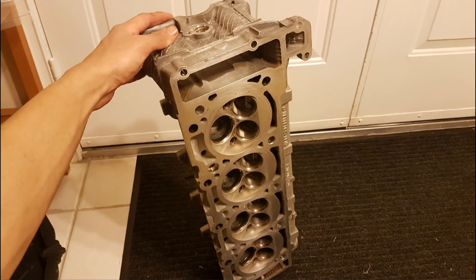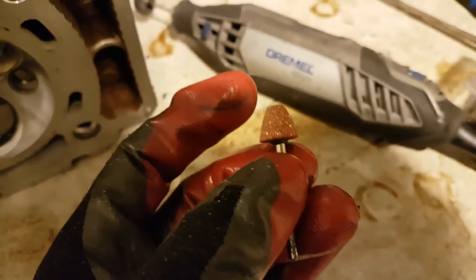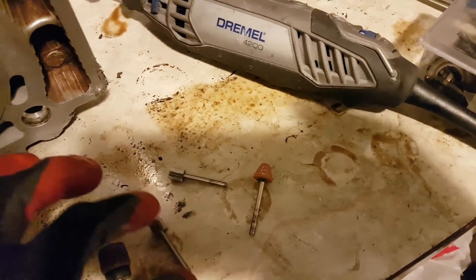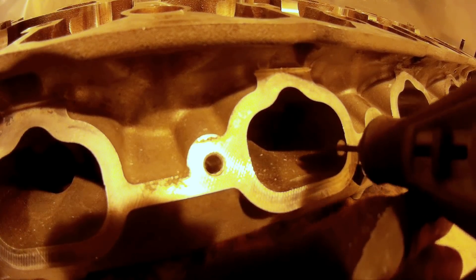Here's what the head looked like after an awful lot of cleaning. Once the heads were clean I could finally get to porting. The tools I'm using are just a Dremel with various bits: a cutting bit to enlarge the ports by a bit, another bit for hard-to-reach places, sandpaper to get rid of the edges the cutting bit leaves, and finally a polishing bit with metal polish. I started with the cutting bit to get rid of all the uneven casting. I enlarged the intake port by 1.5mm and the exhaust port by 1mm. Enlarging it alone won't make a big difference unless the intake manifold and runners are also enlarged by the same amount, but when you're getting rid of rough casting you'll end up enlarging the port anyway.